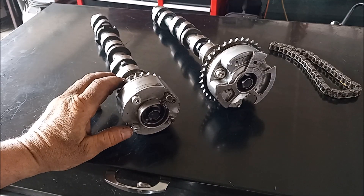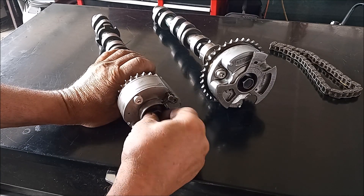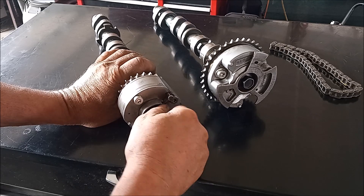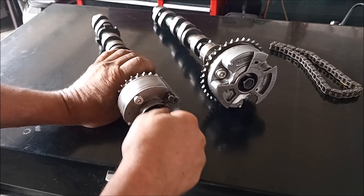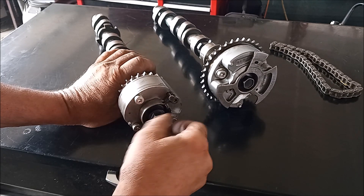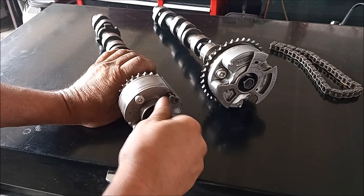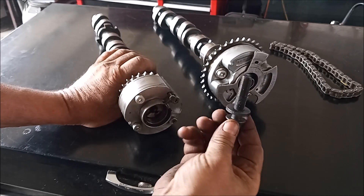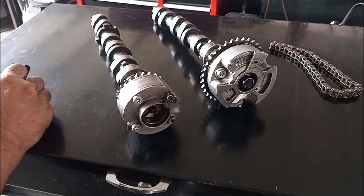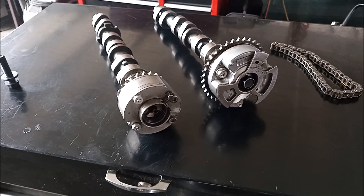It's pretty easy to take the gears off the camshafts. They are just bolted in from the front, and unlike some other VVT systems on other cars, this bolt is not the OCV — it's not the oil control valve. This is just a simple straight bolt. So both cam gears can come off the camshafts pretty easily.